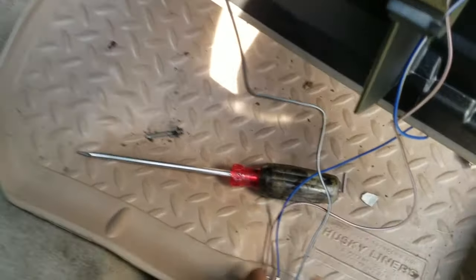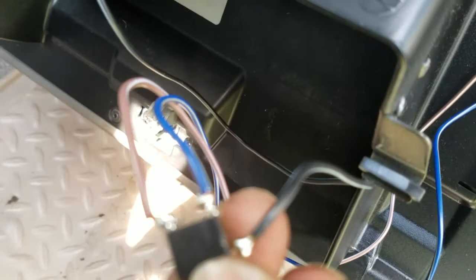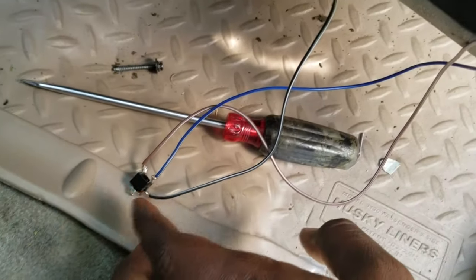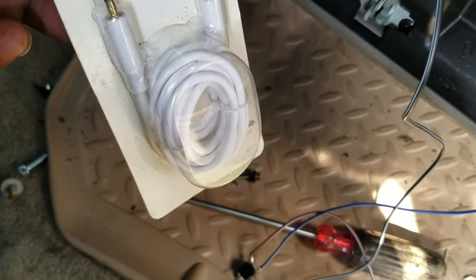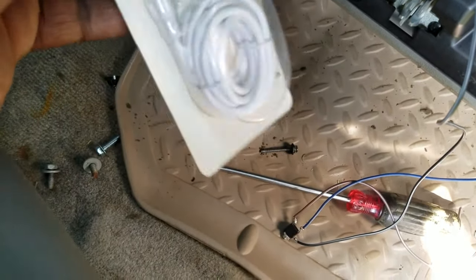For video and testing purposes, I got all the wires soldered up and tied in just to test it before I make everything neat. The side pin ties into the black and white for ground, the right channel ties to the green and white, and the other one ties to the brown and white. It won't make a difference if you switch the two channel wires around — just make sure the ground is on the black and white. As for the auxiliary jack itself, honestly they all eventually get a short, so just get a few from the dollar store.